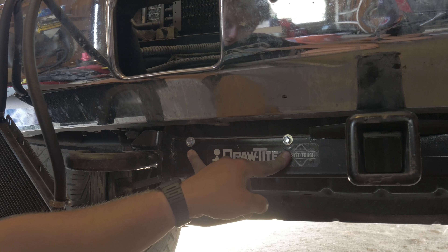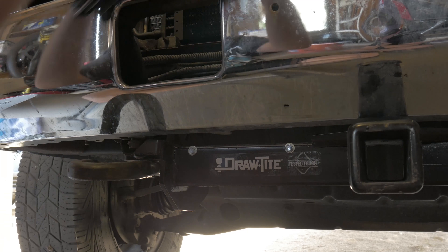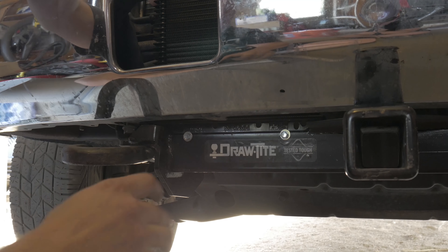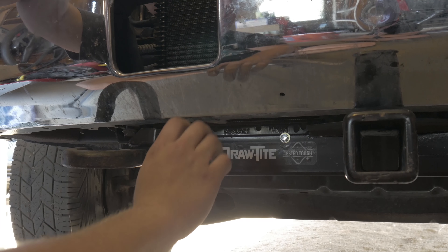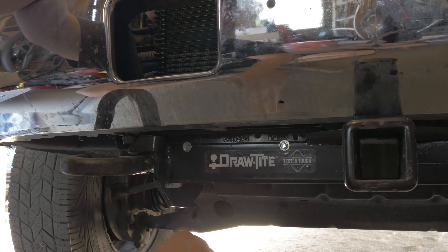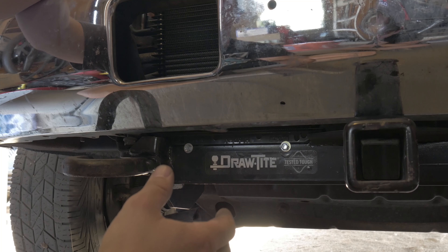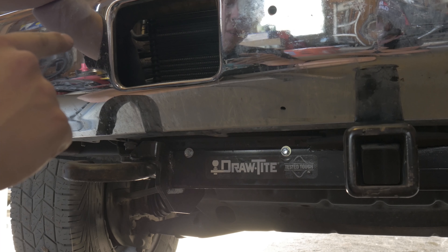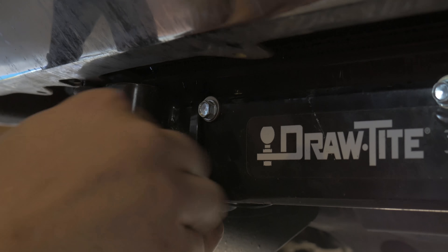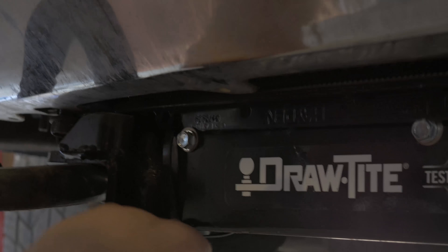I ran these two self-tappers in here — not to bolt the cooler in, but as support so I can zip tie it down and it's not going to try to move. Zip ties are, in my opinion, better here because everything up here is loosely mounted, it's rubber mounted. So if we rigid mounted it to the chassis, which this is rigidly mounted to, torsion and stuff could actually mess up the cooler.